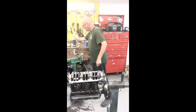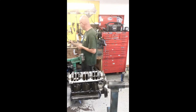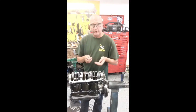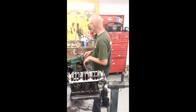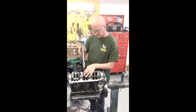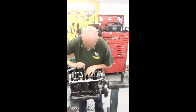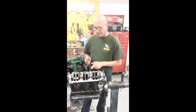Sure that's tight. A little squirted two-stroke oil. Okay. Third one over. Like I said, if it doesn't match, the motor goes boom. It's such a nice fit. Once you tighten up these rod bolts, they're brand new by the way, you won't be able to see the seam, which is pretty nice. Perfect fit. Now we have to do it 5 more times and we're all set.